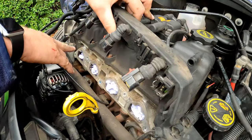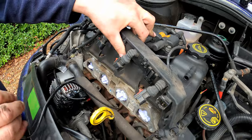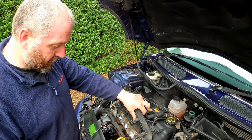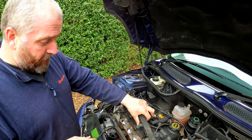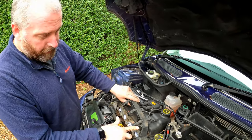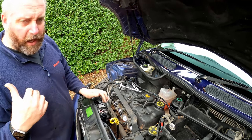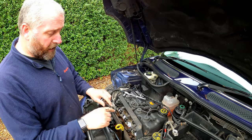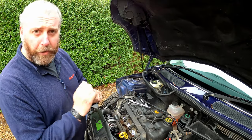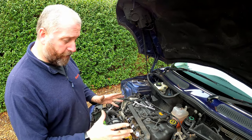What we need to remember is that the cable from the knock sensor connects into the loom here, so it needs to come up through the manifold. We also need to remove the dipstick. We're going to replace all four gaskets on the manifold. The bolts that hold the manifold onto the cylinder head had blue Loctite on them, so I'm going to clean all the old blue Loctite off, add new Loctite, and then get them all fitted. I'll get the manifold prepped and then mount it up.